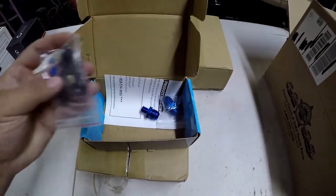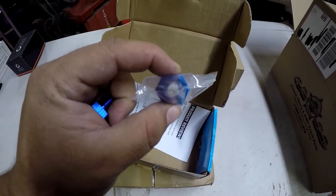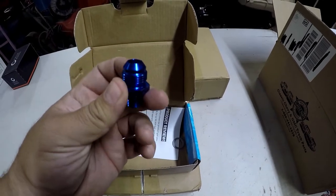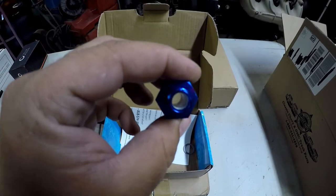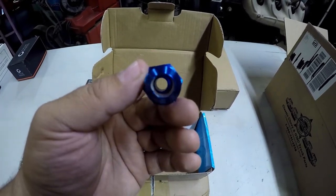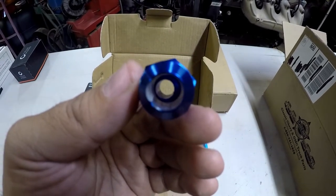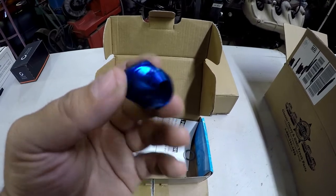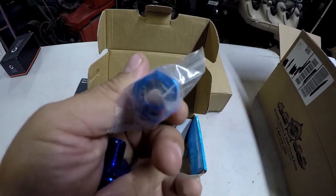It comes with pretty much everything you need to hook it up. The only thing I didn't like is that the inlet is a true 8AN fitting, but the outlet — while it's labeled 8AN — the little hole was tiny. I ended up sticking a drill bit in there and drilling it out as far as I could to almost make it the same diameter. There's still a little lip in there, and unless I get in with a die grinder and tiny bits, that's as close as I'm going to get. I wish it would've just been like the inlet — that one's huge.